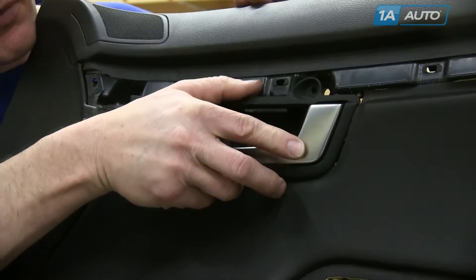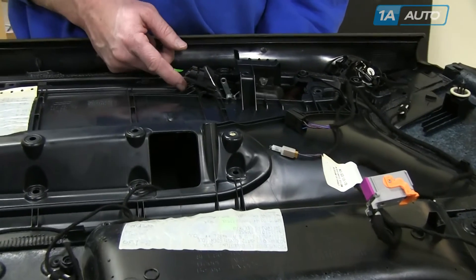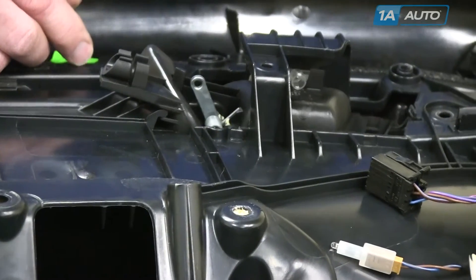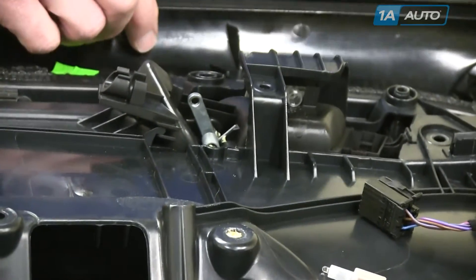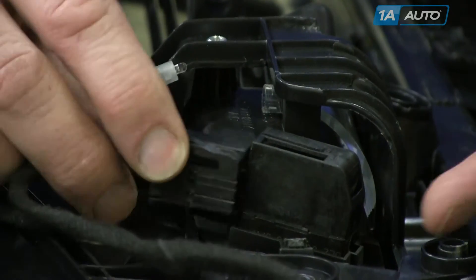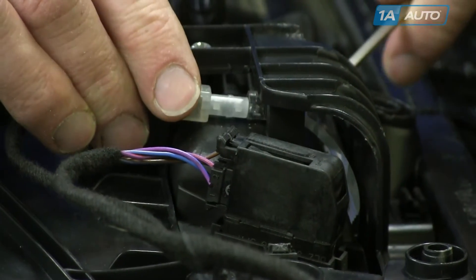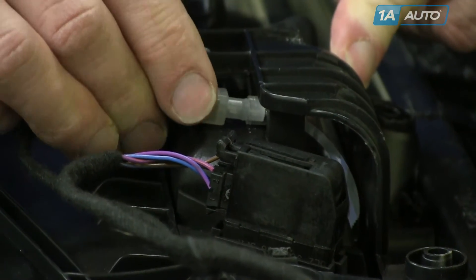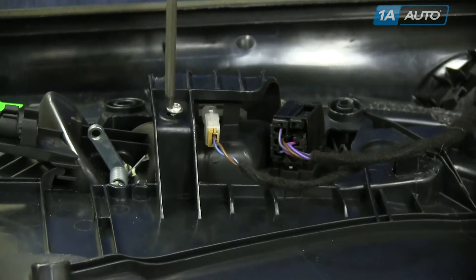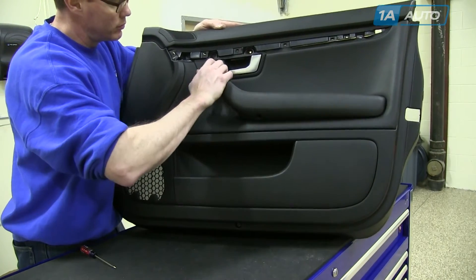Install the new handle — put it in place. When you're putting the handle in, make sure this tab comes all the way over the plastic here so the handle can go back. Reconnect your lock and the courtesy light. You might want to push on the back side — I'm pushing with the screwdriver just to hold that lens in place. Reinstall the T20 Torx screw. Put the armrest back in place on the door panel and then turn around onto the backside.